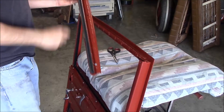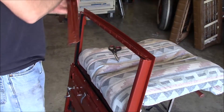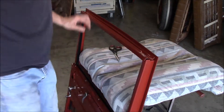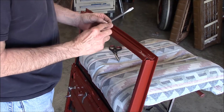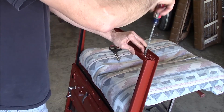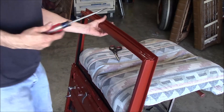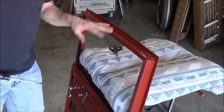Got my rubber piece glued on there — I think it's pretty dry now. This just sets on there and it's got three screws here to hold it. These holes are bigger than the screw tops so I'm going to have to put a little washer on a couple of them. Earlier I ran a tap through all these threaded inserts in here so that my screws would go in good, make sure they were all good — I had to repair a few before I painted the door.